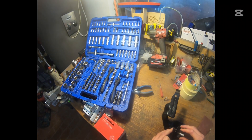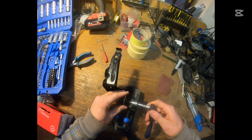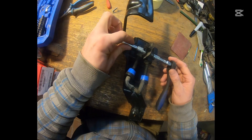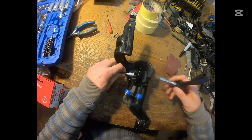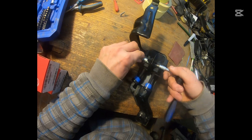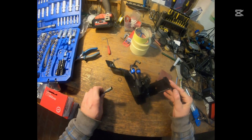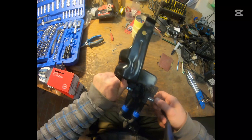Here we are back reassembling the bracket with the two valves in the desired position. It's a straightforward task — there are two bolts, I think M6 or M5, with a hex socket on one side and a size 8 socket on the other side, so it's just a matter of unbolting and bolting back. It's a good idea to use some waterproof grease on all these fasteners in order to be able to get them back off if needed, as they are quite prone to corrosion being exposed to the elements below the vehicle. Make sure you take some photos when disassembling so you can reassemble correctly.